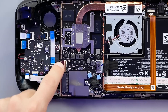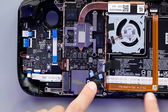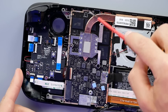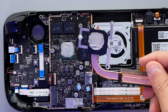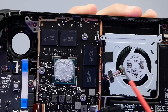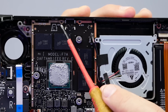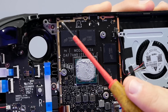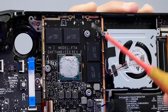Back to the board itself - we have several cables plugged in here and again they're all labeled. We have MB for motherboard. The battery is already unplugged. There's our fan cable and a bunch of other cables running down around to this separate board. Two of them look like antennas, so those will just pop right off. I see two smaller screws and looking at where the heat sink screws in we'll just have to grab these two. The heat sink is up and there is no shortage of thermal compound on this one. It doesn't really hurt it at all - it's just funny how much Valve decided this thing needed. They've also labeled what looks like the screw types that go through the motherboard: M1.6 down here, and M1.6 up top but not where the aluminum goes over first. This is really good for helping you get this thing apart and also get it back together in the right order.